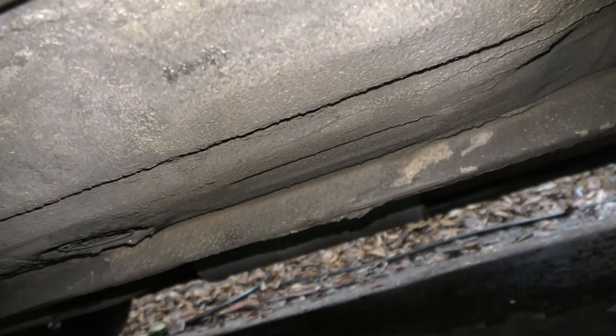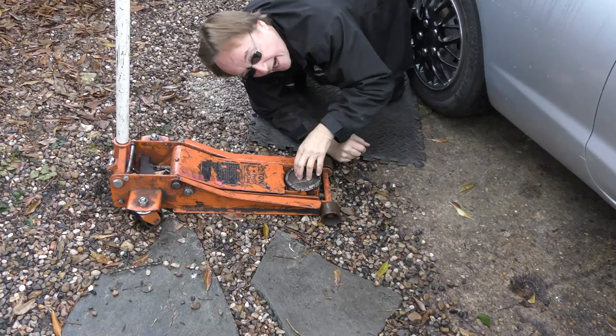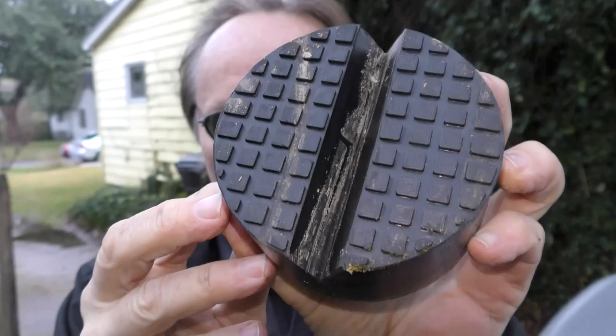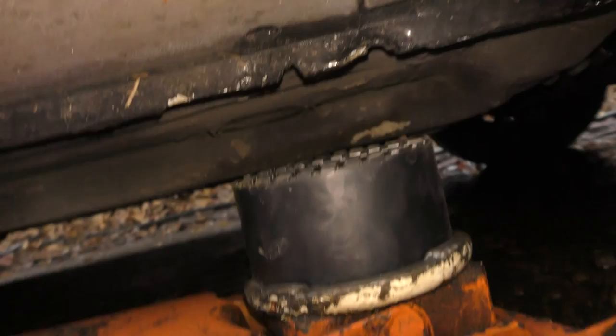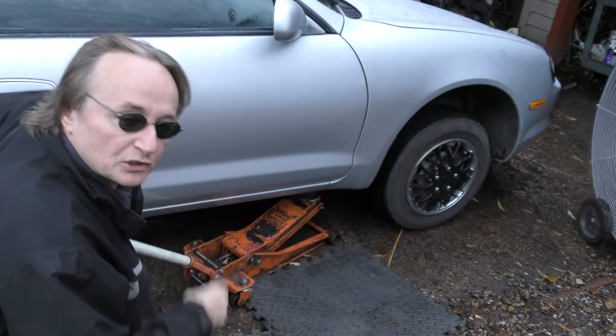Instead, many cars have these special little holes here that a jack is supposed to fit in and jack it up. But a lot of times these jack saddles don't fit on there that well and they'll either slip or they'll bend that part of the car. But there's a special tool you can get — looks like a giant hockey puck, only it has a V-slice sliced in it, so it fits right in there. You just place it on top of your jack, then as you jack it up in the air, it slides right into the groove, and then the car's jacked up in the air nice and safely — it won't slip and it won't bend anything. It's a pretty nifty idea.